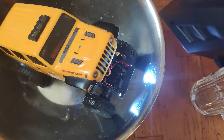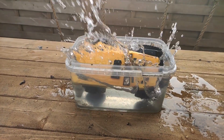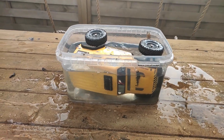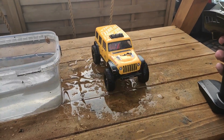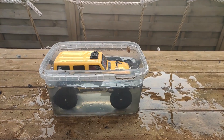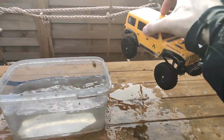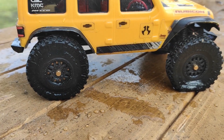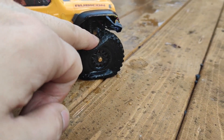It seems to work fine, so let's take this car outside and try something harder. After a few tests, the car still works great except for one minor issue: by pushing the weight inside the front wheel I had damaged the tape covering the vent, and water got inside. To solve this problem without removing the tire from the rim, I had to remove the weight carefully, vacuum up as much water as possible, and then let the tire dry for a few days in a warm place. If you like this video, give it a thumbs up and subscribe. Have a great day and see you soon!